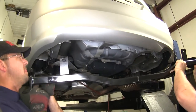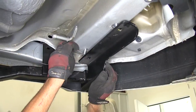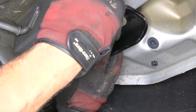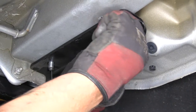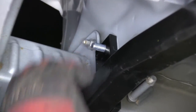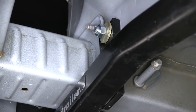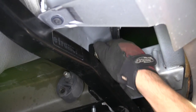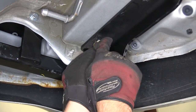Now with our frame hardware in place, we're ready to go ahead and install the hitch. It's a good idea to get extra hands to help hold the hitch while you install the fasteners. As we put the hitch into position, we'll take the pull wire and feed it through the attachment points of the hitch and bring it tight to the frame. Once we have it tied to the frame, we can go ahead and install our fasteners. Next we'll install the vertical hardware — this will be the bolt and flat washer going through the body, then through the hitch, and getting secured with a conical tooth washer and nut. We'll repeat this same process for the opposite side. We'll then remove the pull wire from the rear frame fasteners and install the conical tooth washer and nut.